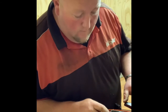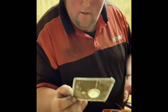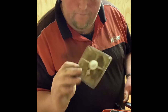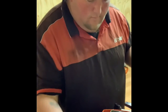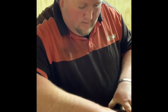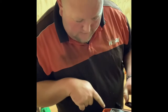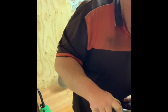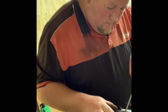So one thing I've noticed straight away is the sawdust is getting under this air filter. That's because it's stuffed. A hole in the fleece there. Not only that, the tank screw here was loose. I think the whole carb is coming with this. Try and, there we go.